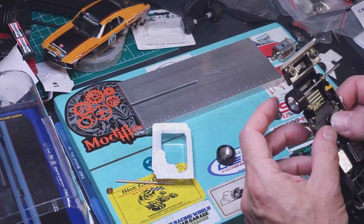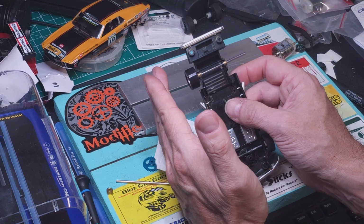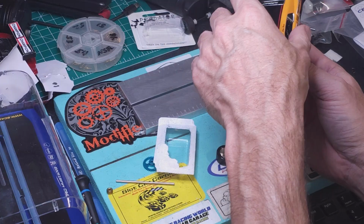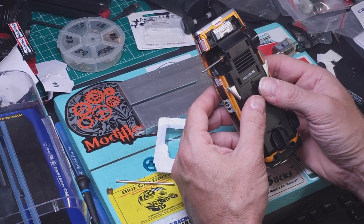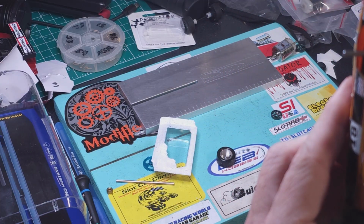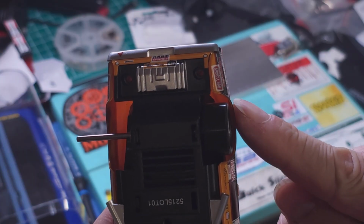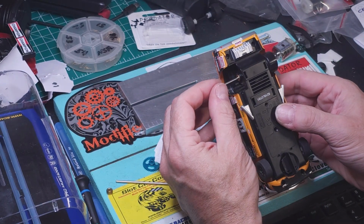See what this is going to look like for us. I want to see what this is going to look like without any spacing, right up against the bushing with body. Okay. So without any spacing, it's already super tight, right? You got a little bit of daylight. There's a little bit of daylight right there underneath that wheel and that tire. So maybe there's some room to play.